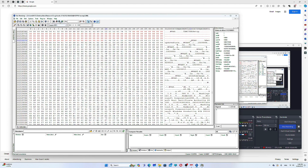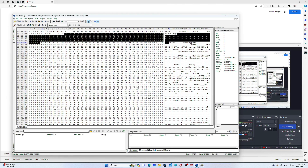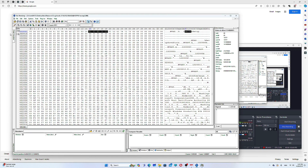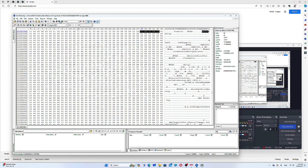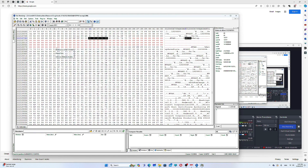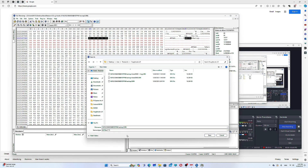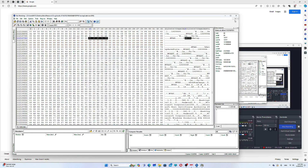Let me check if there is still an AMITSE instance in another place — if there is something we need to fill it with zeros too. There is nothing here with data. Going to the next one — here we have another AMITSE but nothing between it. So what we edited was the one with data. I'll go to File, Save As, and name it 'backup2 unlocked.'